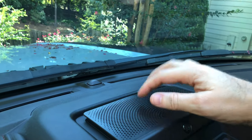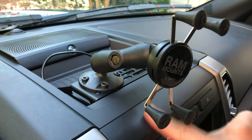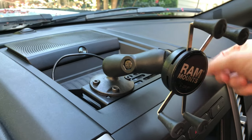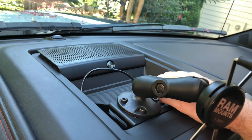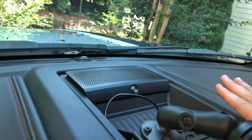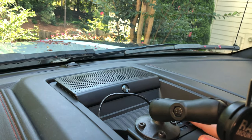That's how this comes out: take out the two screws, and then there are three clips here — one in the middle and one in each corner. Be really gentle, just pop this out, and then this whole panel can be modified how you need to modify it, just like I showed earlier in the video. That's really easy to do.